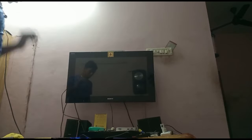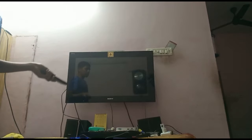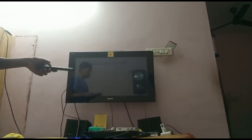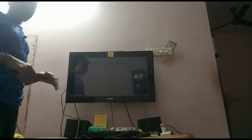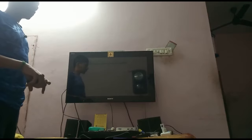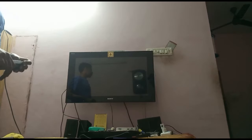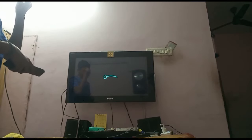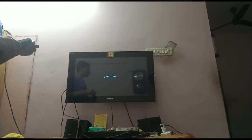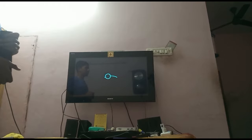So once you reboot, you're going to notice that the Google Play Store will be available, as well as YouTube, which comes basically pre-installed already. You can install any other OTT platforms you like, so any app, but mostly any app that runs on a smart TV. So yeah, right now the Konstakang version of the Lineage OS has minor glitches in Disney Plus Hotstar. So other than that, it runs everything, including Netflix.